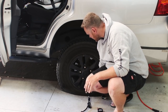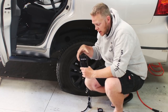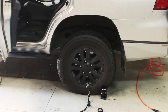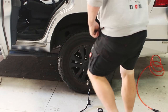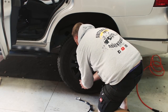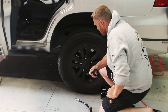Pulling the deflator down. Plug in, pull the valve stem out — that's probably the only extra step compared to just flipping it on and running it. Going to turn the compressor on and start the timer at the same time. We'll see what PSI it's sitting at after a minute 30 again. Pulling it off — ho-ho! So that's 28 and a half, but the device is still on. I'm going to get 6 extra PSI just by using that.